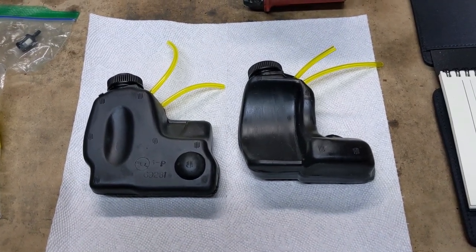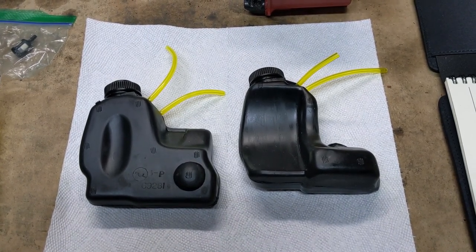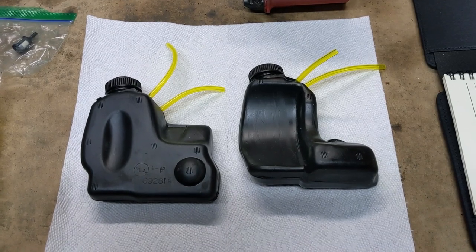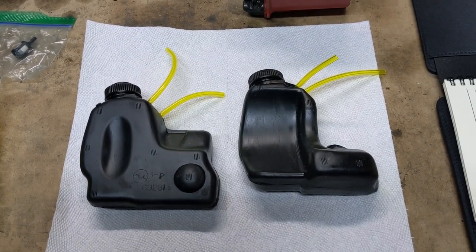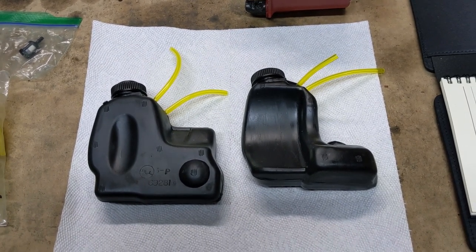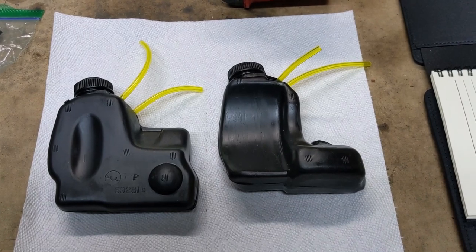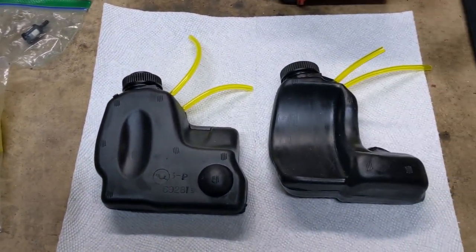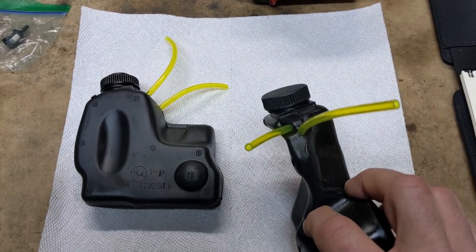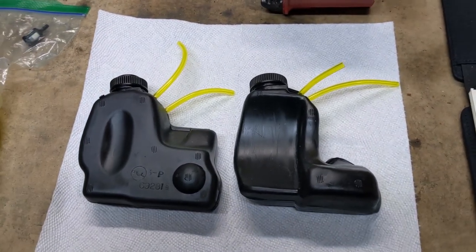Welcome back guys. This video is about replacing the fuel and oil lines on a chainsaw. In this case it's a Homelite Little Red XL, which has an automatic oiler that works off of pressure from the crankcase through the carburetor. It's got a couple of different hoses that route it, and I'm using Tygon line here. You have to have the right size that's big enough to fit tight in the plastic tanks but not so much that it restricts or squeezes the inside diameter.